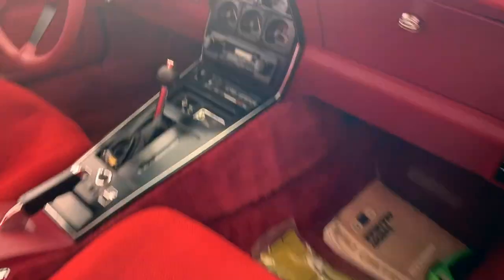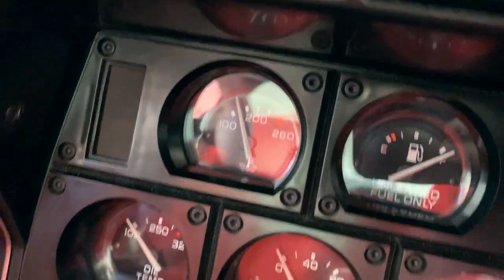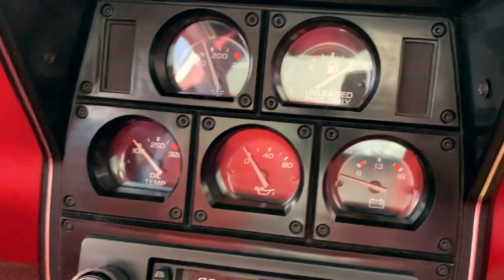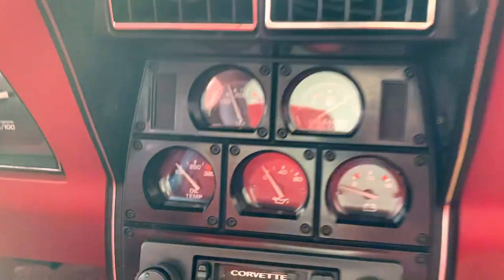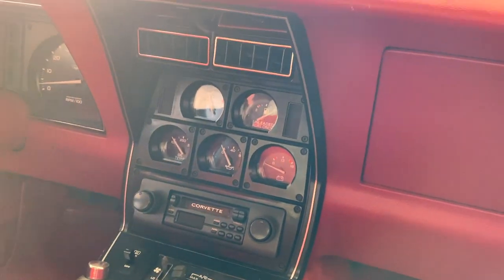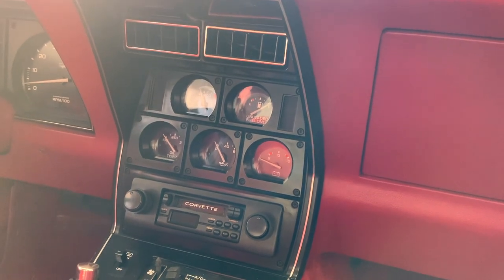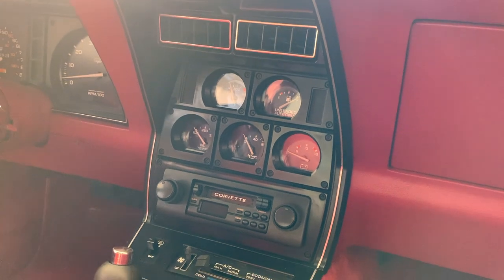I think it's going to be a huge improvement to what we currently have in the car, but we're going to hold off on putting the radio in today because I'm still waiting on a couple of parts. The temperature gauge - I've put in a new sending unit but the gauge is still off, so I've got a resistor coming in for that. The fuel gauge likes to bounce around when you're driving, so it's worn out and I have a new fuel gauge coming in. The oil pressure gauge does the same thing, and the oil temp gauge does absolutely nothing. I've ordered all this from Wilcox - and surprisingly, the only gauge that actually works in this car is the volt gauge. It's all one piece with the radio, so I'm not going to take the radio out just to put a new radio in.